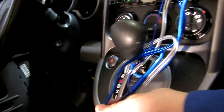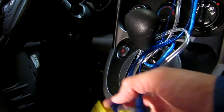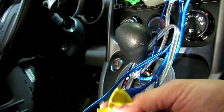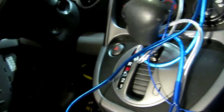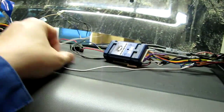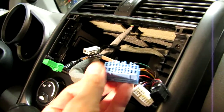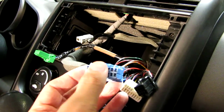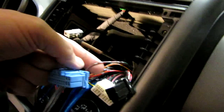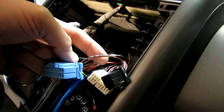And anyways, as far as these RCAs go, I've just taped the ends of them, so as I'm playing around, the connections themselves aren't being scuffed up or anything like that. Alright, so insofar as the connections themselves, the white wire that I mentioned is supposed to connect to pin number 3 of the Honda 20 harness, which is this baby. So you count 1, 2, 3 on the top row, and it corresponds to this Christmas tree colored wire here.